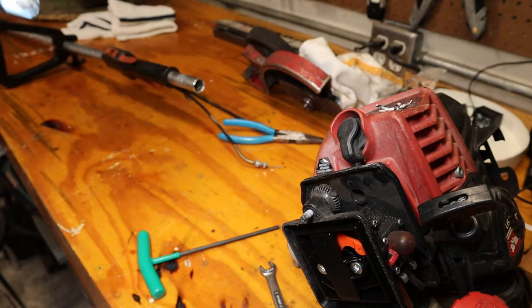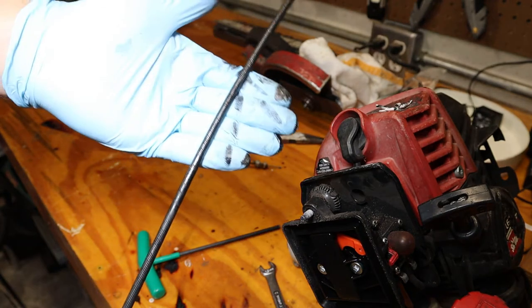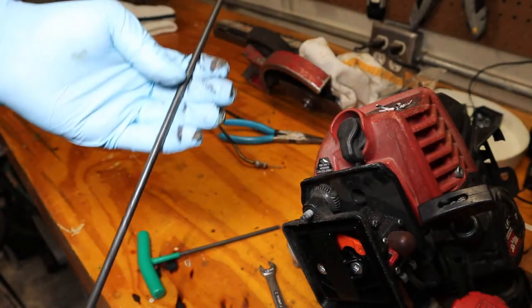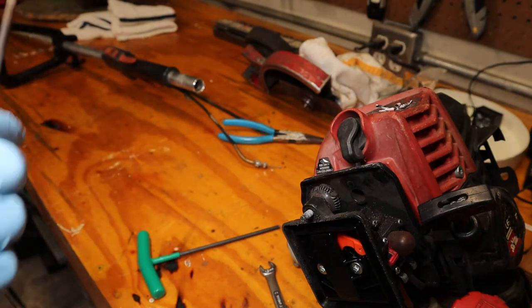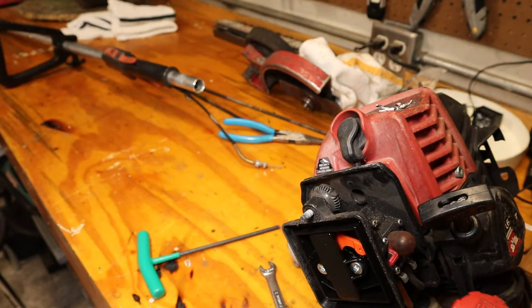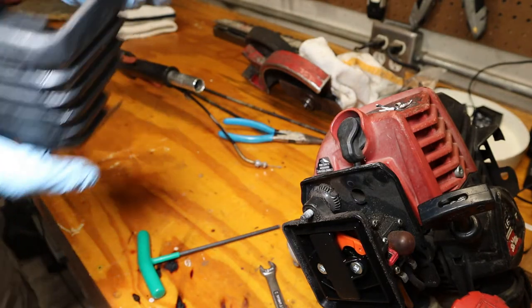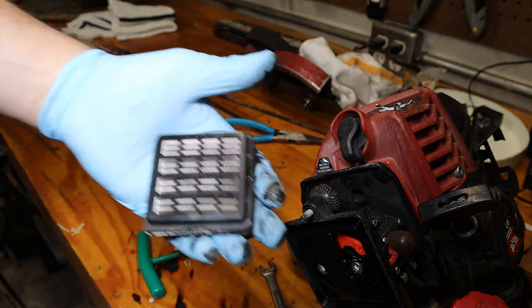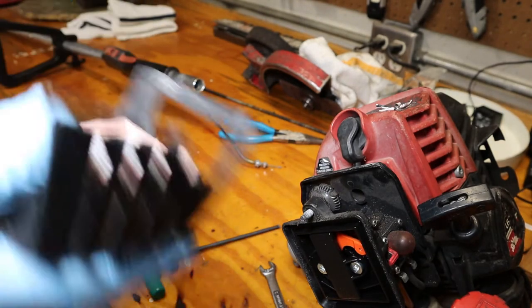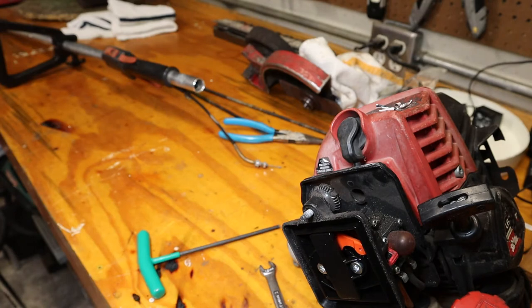You can see the flex cable is pretty highly worn right here - it's almost worn smooth. It doesn't look like it was ever greased, that's probably part of the problem. So time to order a cable. Let's see what else this thing needs while I've got it here. How's the air cleaner look? Not horrible, not great. Let's see what parts for this thing cost.